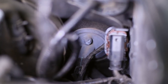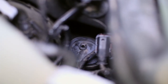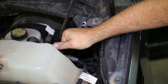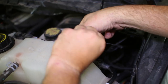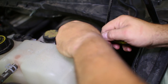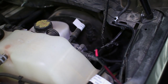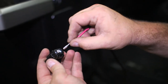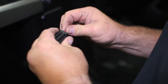We will start by making a small incision in the grommet on the driver's side of the firewall to pass the power harness into the cabin. It was easiest to feed a lead wire through the grommet and tape the power wire to it so we can feed it through the cabin a little easier. Then install the black 2-pin power connector on the subwoofer power harness — push the wire into the slot and it will click into place.